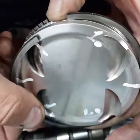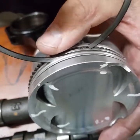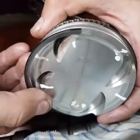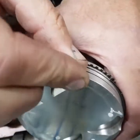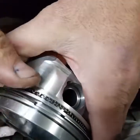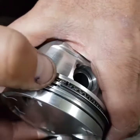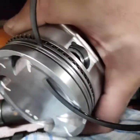If you don't have ring pliers, it's still very simple — it won't damage the piston, won't damage the ring, and there's less stress on the ring. Start by inserting it, lift this piece over, turn your ring over and then gently start pulling it down. You're going to scratch the piston a little bit, but that doesn't really make too much of a problem. If you are a perfectionist, you'll probably take a little bit of sandpaper and get it out. That is the easiest way to get your ring on. To take it off, same simple way: lift it, twist it, over the lip, pull it up, and it's off. I prefer the pliers — the pliers are actually way easier.